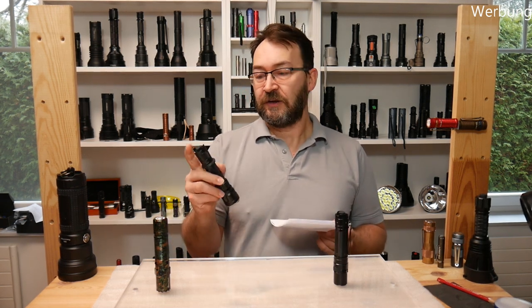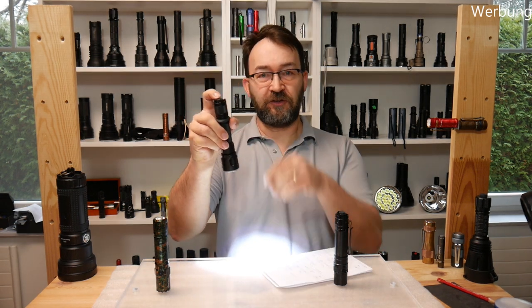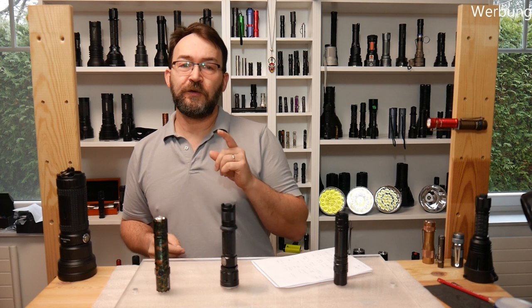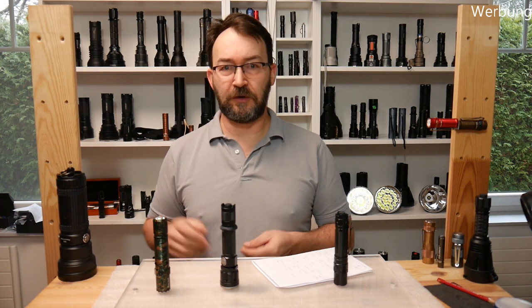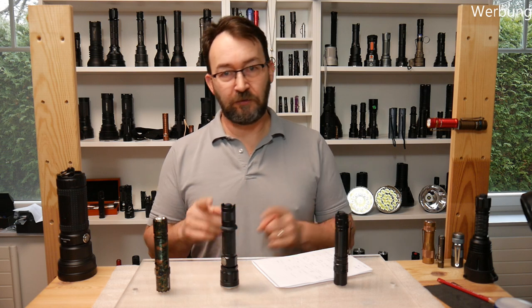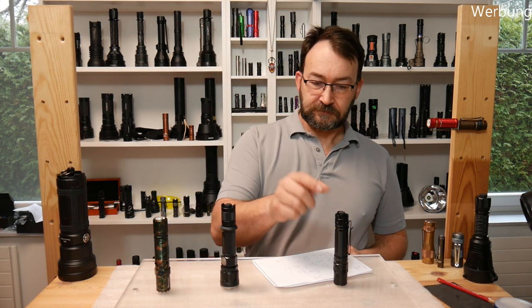And to charge, you have to click switch it on, and then when you plug in the charger, the light goes off and it is in the charging cycle. And it did not work on a USB-C to USB-C cable, so the high power USB-C protocol does not read in there, and it does not allow to charge. So you need USB-A to USB-C. But charging itself, well done.